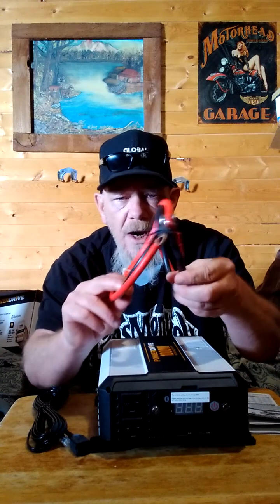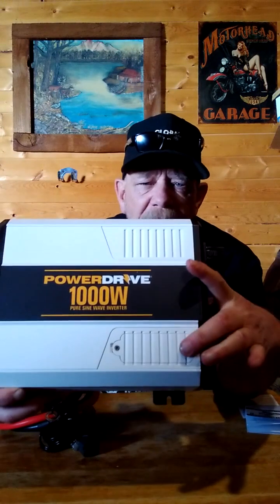It comes with three-foot, eight-gauge connector wires that go to your battery — red to positive, black to negative. On the back of the inverter are covered plugs. Just unclip these and it has a bolted nut inside. Connect red to red and black to black, then connect to your battery. Simple setup. On the top it has a small flap with a screw — that's where your blade fuses are, the same type found at any automotive store. About four blade fuses are inside. If something goes wrong, you can open it up, check the fuses, replace if blown, and get it back in order.